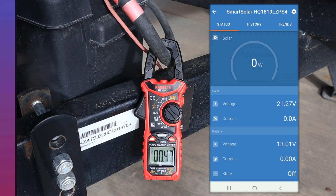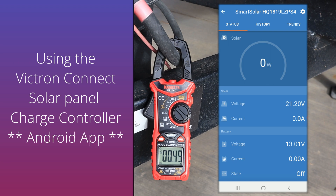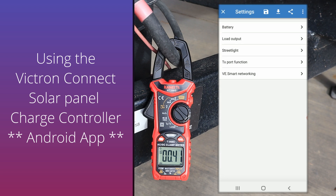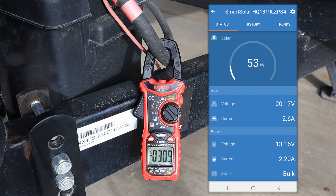Now I'm going to turn back on the solar panels and watch the power get put back into the batteries. All the appliances are off in the RV and just the essential one is running — that's a half-amp draw. What you're going to see is a negative number; that's just because I need to turn the clamp around to show the right direction. I turned the solar panels on as you can see with my Victron smart solar charge controller, and it's filling up the batteries now.